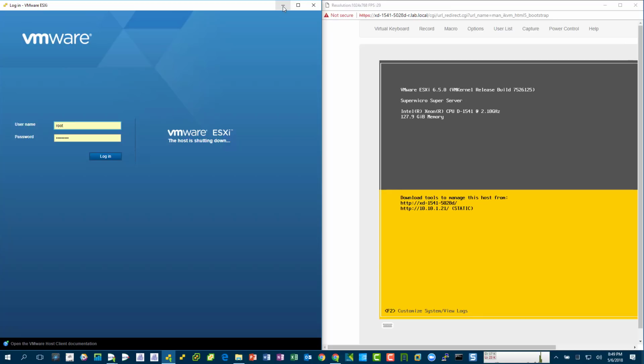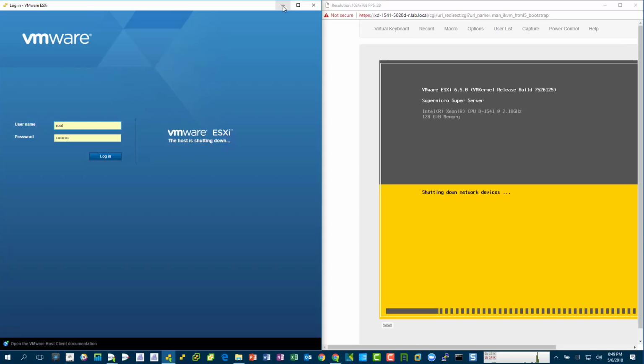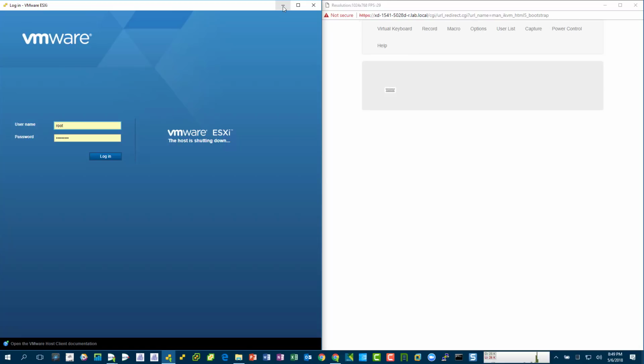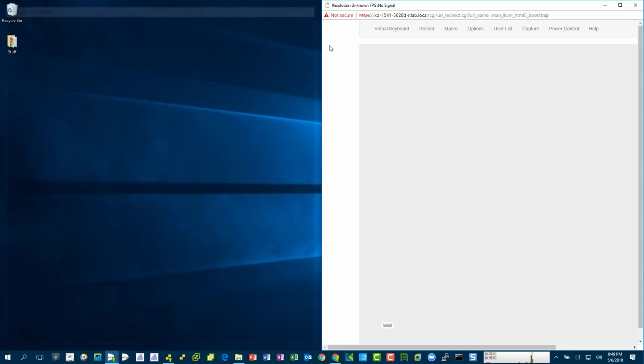Now, with tools like Clonezilla, if you mount an ISO, you can clone USB drives on a server from one to another, but what you're missing there is an easy way to also save an image file. Same with dd on Linux. So I like the technique I'm showing you in that the only prerequisite is a Windows machine with USB ports on it. Mine happens to be a laptop with two USB 3 ports, which is also important for top speeds on getting this job done. So I'm going to close that because we're done with the host client. And I'll just minimize that; I'll bring it up again later.